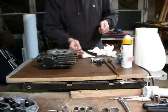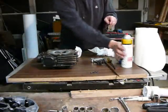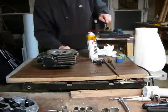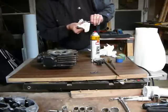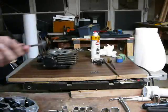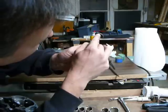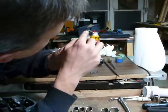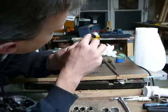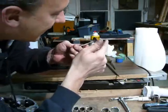I'm going to use a fresh clean paper towel, wipe this off, give it a blast with the carb cleaner and give it another quick clean off. What we're looking for is a nice clean ring all the way around, a nice uniform surface. There might be some pitting and stuff like that — I have a little bit of discoloration, but nothing that looks like it's going to allow the gases to pass by.